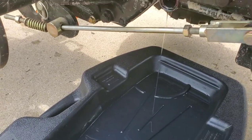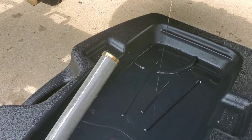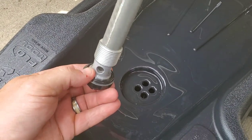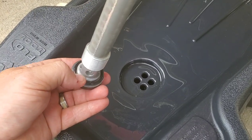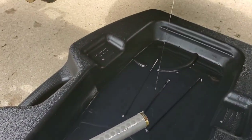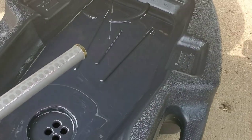And this is almost done draining out. One thing — just like with all the drain plugs, you need to keep an eye out for especially on this one because it seems to fit a little bit looser than the others — is that rubber washer. Make sure that is back on there before you install the filter again. Once this is finished draining we'll go ahead and put this back in and tighten her down real good.